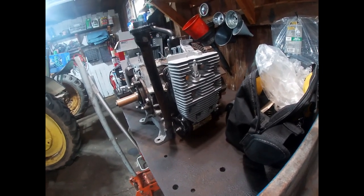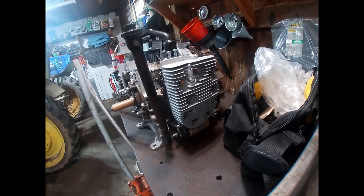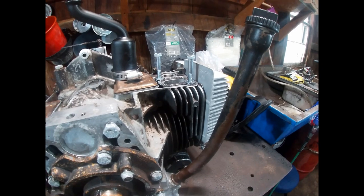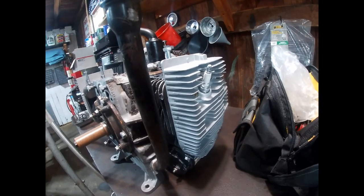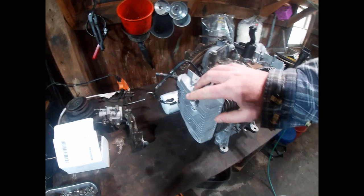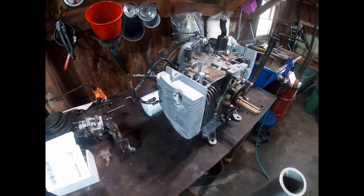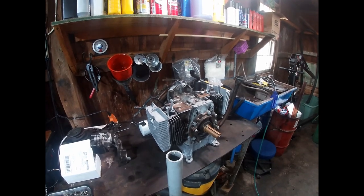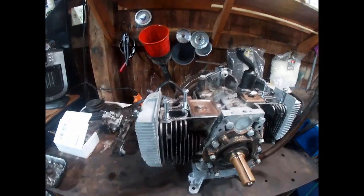These Onans are a little tricky because they use two different sizes of head bolts — some later engines even had three different sizes. I used a 5/16 by one-and-three-quarter or two-inch long bolt, and tried to keep it as uniform as possible and torqued them all to spec. I also installed some new spark plugs — I'm running the hotter Champion RS 17 YX. These would have originally had a RS 14 YC, but the 17s are a hotter spark, at least that's what Onan recommends in the later manuals.